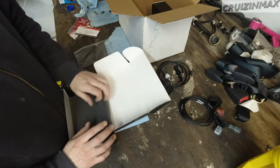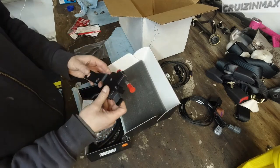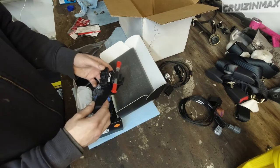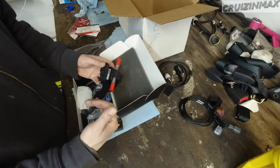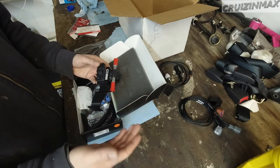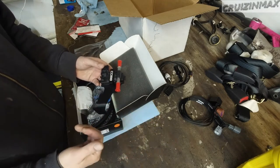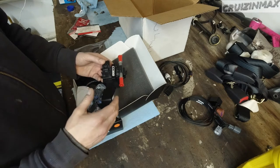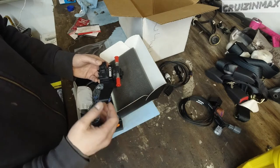And the third and last box: this is the actual flex fuel sensor. This detects the amount of ethanol in your fuel tank as it goes through. I'm going to hook this up on the return fuel line, and this will let the onboard ECU or the Access Port know how much ethanol is currently running into the engine, and adjust accordingly. The beauty of this is I can mix fuels — pump gas between 93 and ethanol E85, any amounts I want.